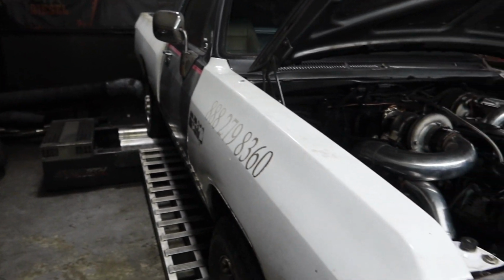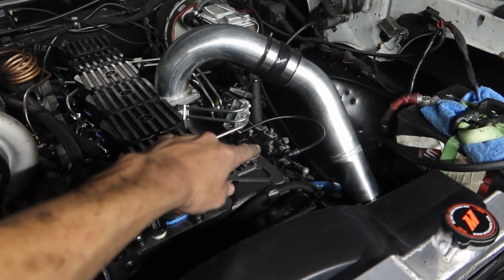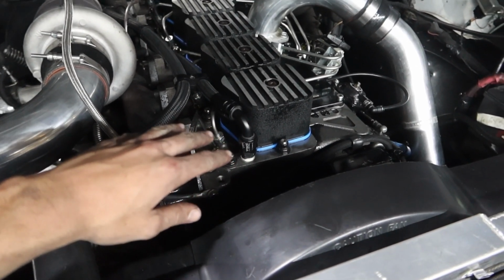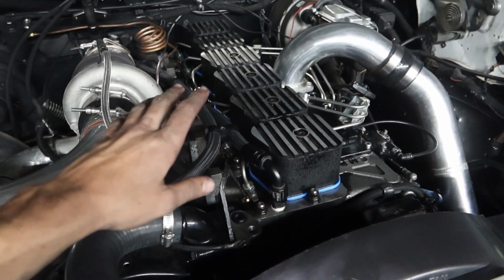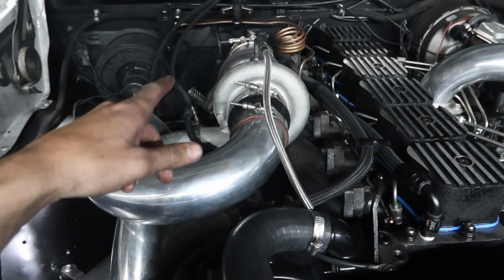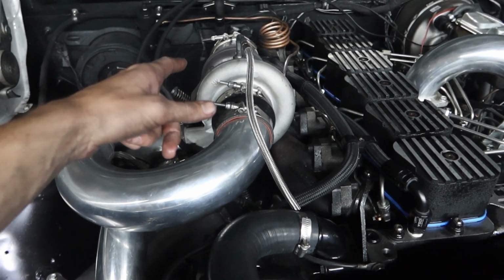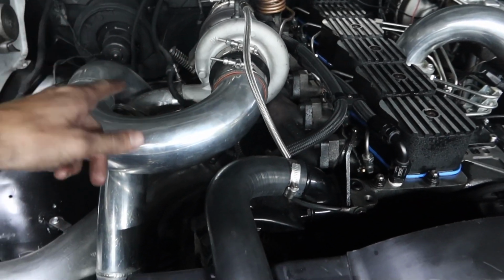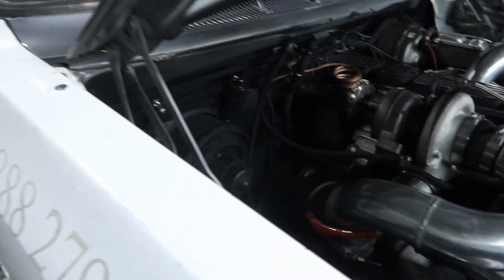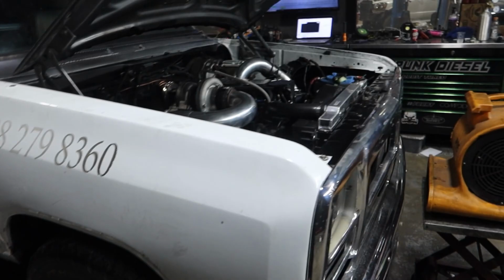We're going to pull it off the dyno. Essentially, if you guys are curious on what it is, a Ratman Performance 12 millimeter pump, the same one that I've got. It's got a Hamilton Stage 1 head, just like mine. It's got 5x18s from THD. They're 5x18 comps. It's got a 60-67-12 from Jade Tellman, a Tellman built with a 12cm Ratman housing. He also is the one who builds the pump. And then it has a Borg 475 on the atmosphere. And it is a 47 swap. And just a sharp little shorty.